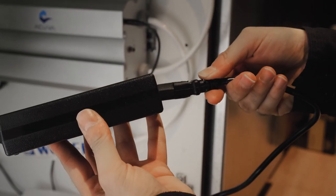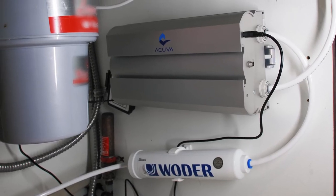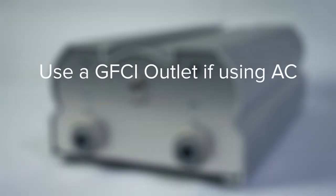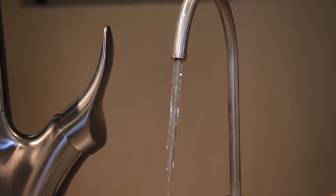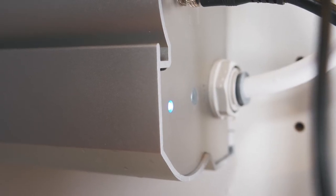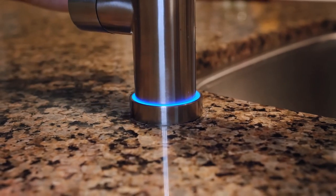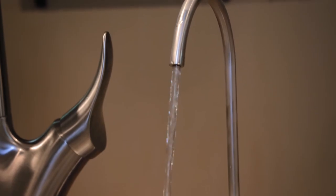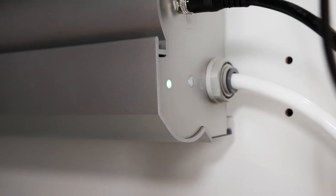Connect using the power adapter if plugging into an AC outlet, or connect directly to a DC power supply. We recommend using a GFCI outlet if plugging into an AC outlet and a 10-amp breaker if plugging into a DC source. Turn on the faucet and the Aero will glow blue, which indicates water purification is in progress. If the Smart Faucet is installed, its base will glow blue as well. Allow water to flow through the system for 1-2 minutes until any bubbles are released from the line. Turn off the faucet and the device will automatically go into standby mode.